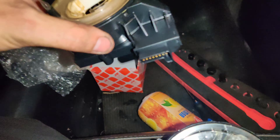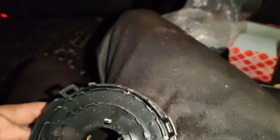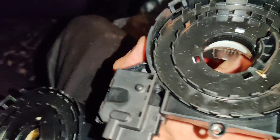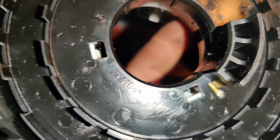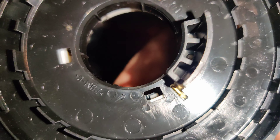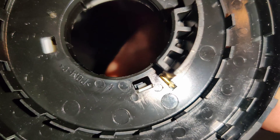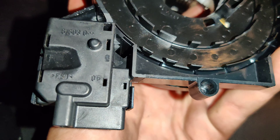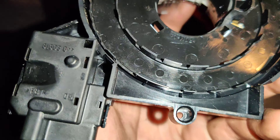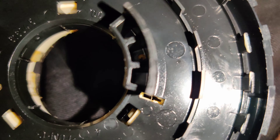Okay, so let's go back. Let's read DTCs again. No codes. Let's go into read data stream, buy list, and we'll select our driver's side airbag again and see what it says. Correct. So there you go guys - we know we need a clock spring and we know we need an airbag. So now if we move these over, this should actually make the horn go off. Yep! See that? Boom. Confirmed - clock spring and airbag.